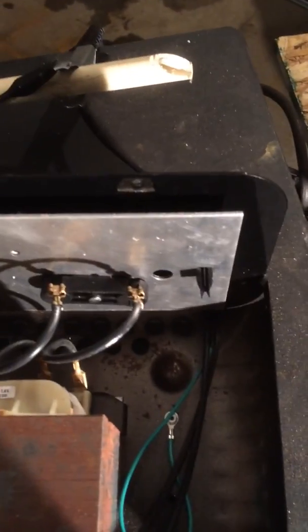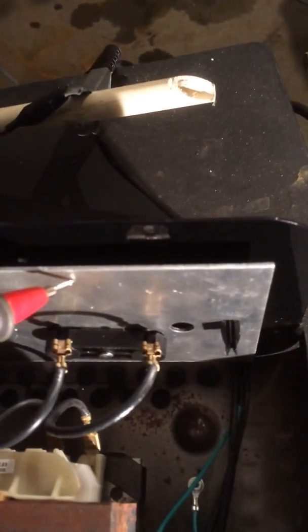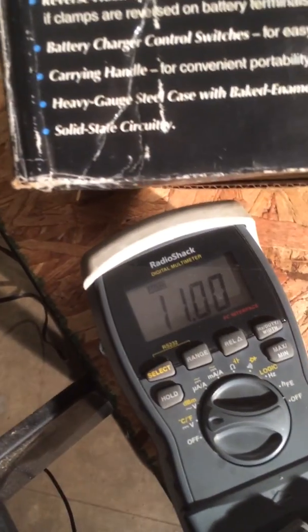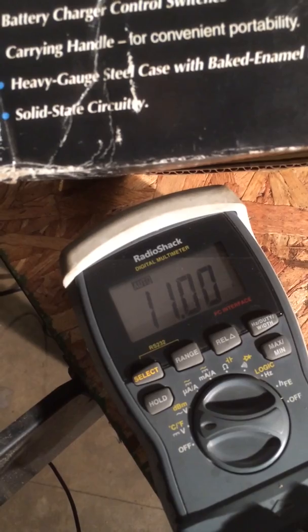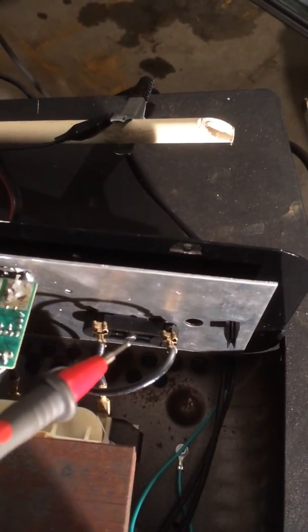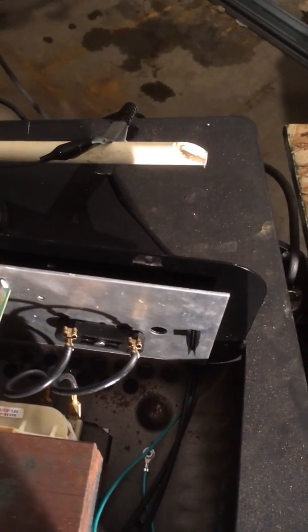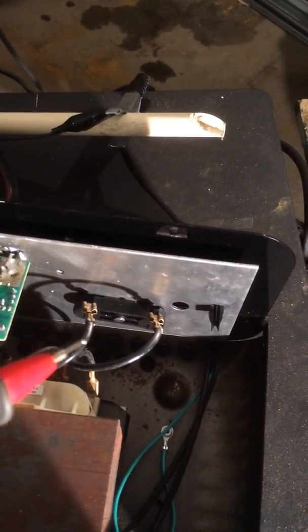Let me look at this plate here. This plate is actually a connectivity plate — it's just not a heat plate. And I test that on DC and I'm getting 11 volts. What happens here is these power lines, AC, come through that black little piece. That black piece isn't just a piece of plastic — that's two diodes. That's what's changing your AC power into your DC power.